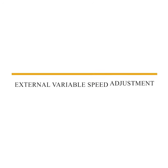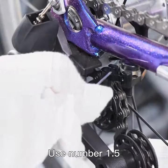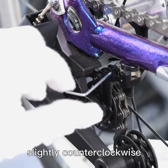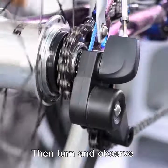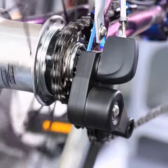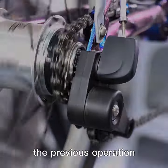The following is the external transmission adjustment. If the chain doesn't respond when we raise the gear, use a 1.5 mm hexagonal socket and tighten the adjusting screw slightly counterclockwise. Then turn and observe whether the chain can change to the upper gear. If the shift is still not successful, continue to repeat the previous operation.